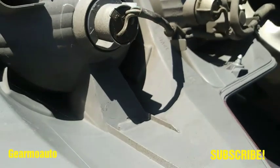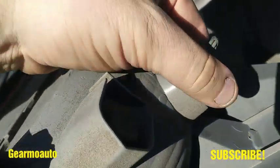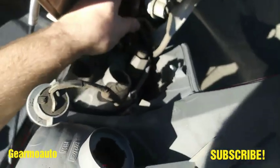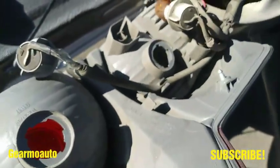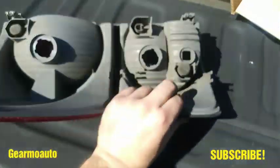So let's go ahead and disconnect the wire harness from the assembly, so that way this isn't just hanging off, getting scratched up or whatever. Go ahead and disconnect these. And like I said, your aftermarket one may not come with a wire harness, or it may, I don't know. But if it doesn't come with bulbs or anything, make sure to switch the bulbs over and the wire harness over if you need to. Go ahead and remove all this. I'm just going to pretend you have a dealer one. So anyways, I got this removed.